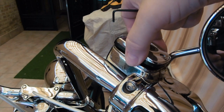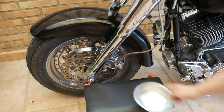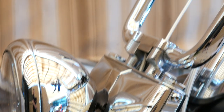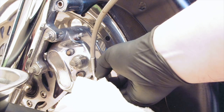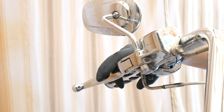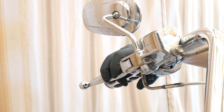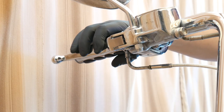I'm doing a major overhaul and decided to flush out all the brake fluid. For some idiotic reason I thought it would be a good idea to take the banjo off the brake caliper. There's a lot of line in here, especially if you have ape hangers like I do. So I cracked the banjo open and started to flush out all the liquid — just pump easy, take it slowly and you'll eventually get all the liquid out.